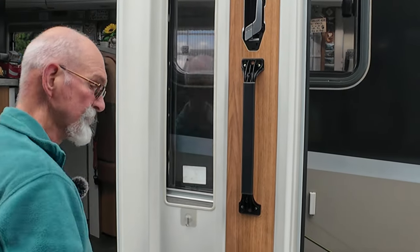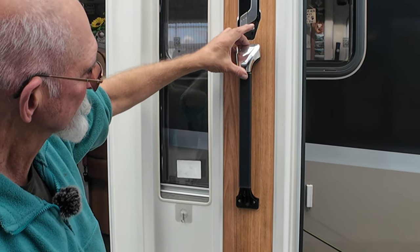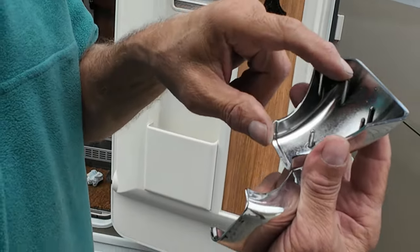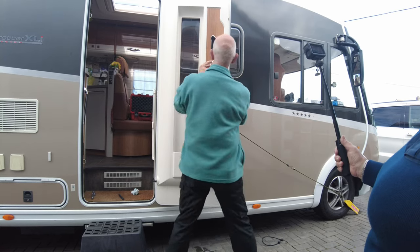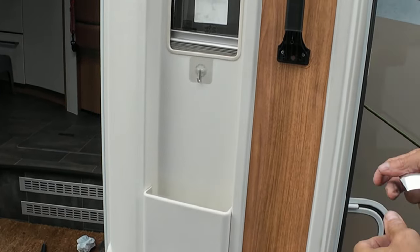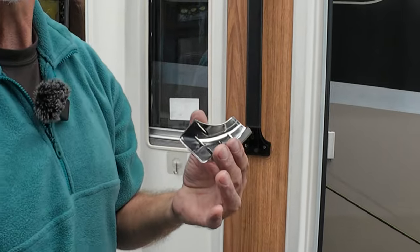And then put the posh trims on. Now, if you can imagine, when you look at it, all you can see is that, so you're not sure how they come off. What they've got is three little spikes, yeah? So the little spikes fit in the hole. To put them on, literally line the spikes up. And then when you want to get them off, literally fingernails behind, give it a little wriggle side to side, and it comes off.